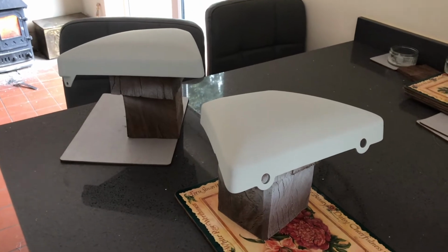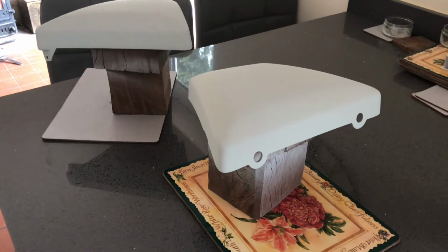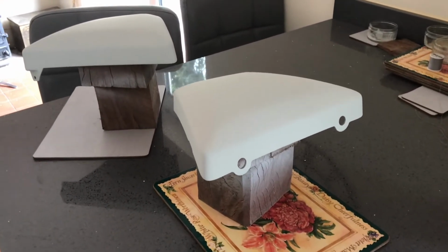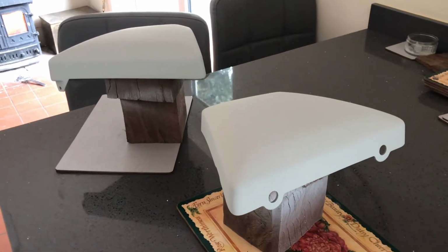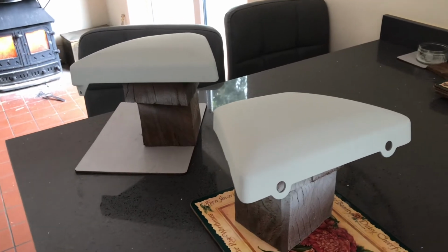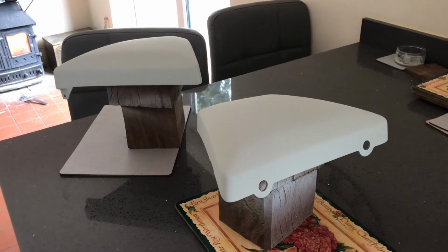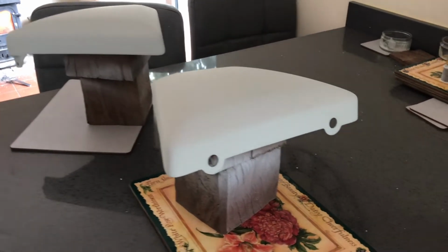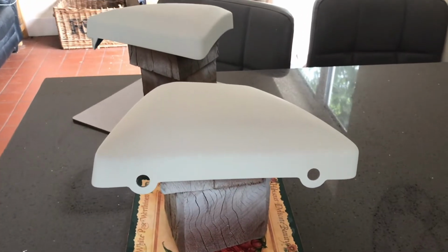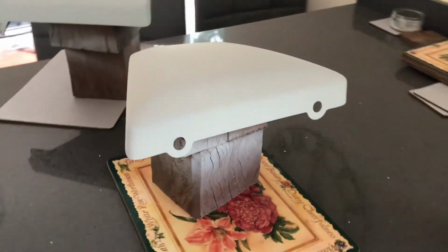And he said that if you then start putting base coat on and then top coat on, even if you do those correctly afterwards and then the lacquer, you've still got solvent trapped at the primer layer. And because it's on plastic particularly, it's got nowhere to go apart from through your paintwork and out through the lacquer, and it will spoil the job. So it's absolutely vital, he said, to make sure that it's completely dry, completely cured, or whatever process occurs. I think it's just losing solvent.